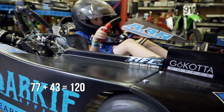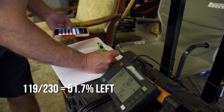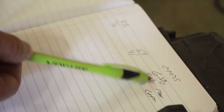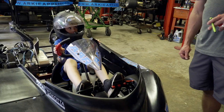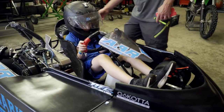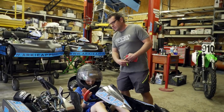Now we're going to do the left. Our left percentage is 51.7, so let's just say 52% left. So it's 52% left, 63% cross, and 50% rear. The only problem with him on this kart — as you can see — we can't really move the seat back. So we'll have to get lead or something, move some lead back here, which wouldn't be bad. I'd probably actually mount some lead to the rear, but we'll find a way to get some more rear percentage in it.